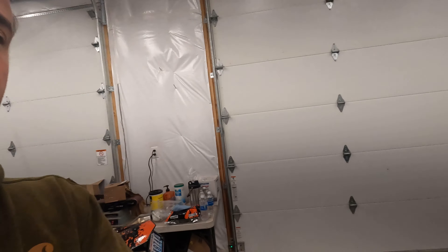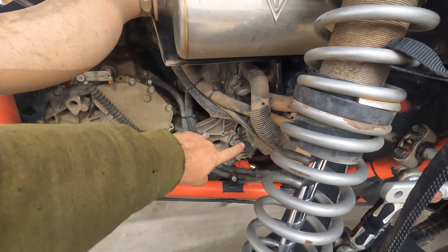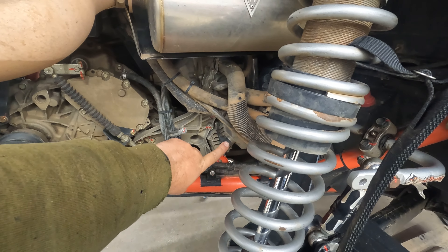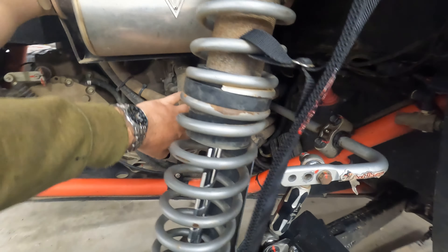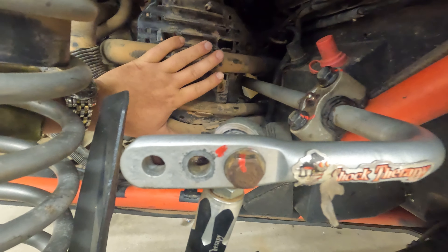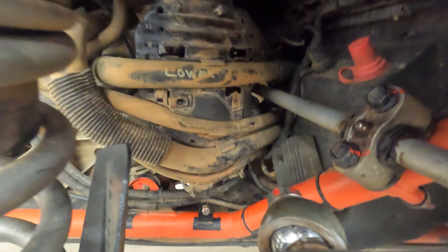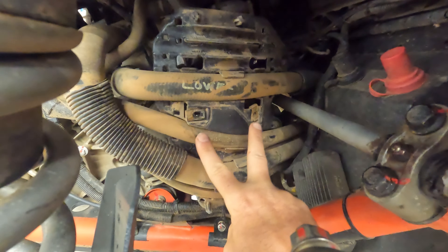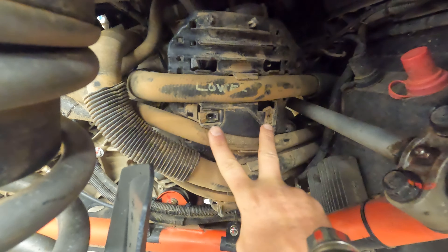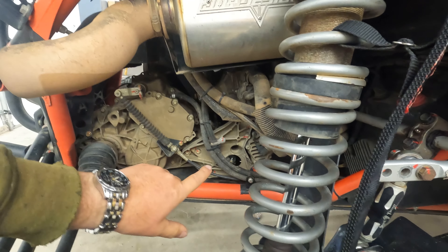Paid for two-day shipping on it, so we are going to tear it apart now. The stator — or magneto as it's sometimes called — is right underneath here, behind all these hoses and everything else. I already took off this outside cover plate. There are T30 Torx screws that hold it on right there, so take those off and then you'll be caught up to me.